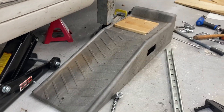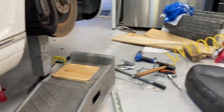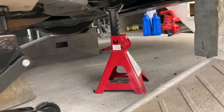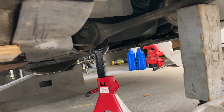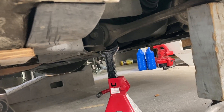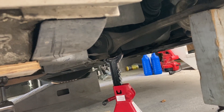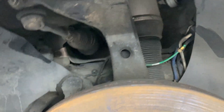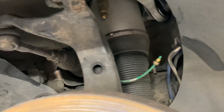I've used rhino ramps and basically a whole bunch of wood to get it to where I can get a jack under it, because the front airbags had failed. I've got a stand underneath the control arm attachment point, which I'm not wild about because it's cast aluminum, but it's better than nothing — definitely better than the car falling.